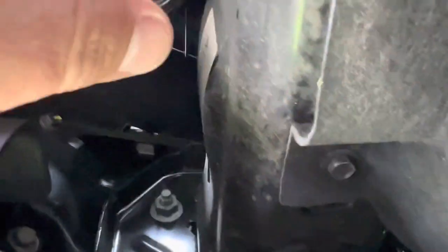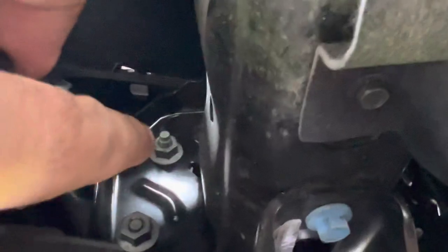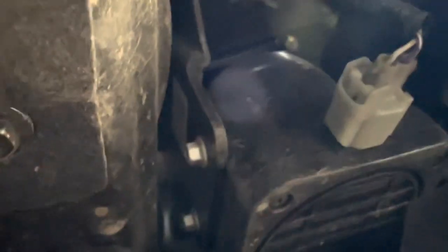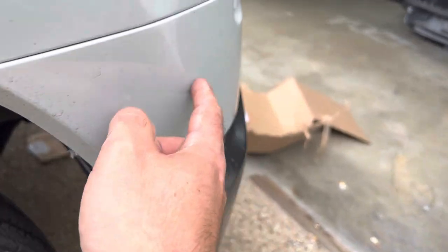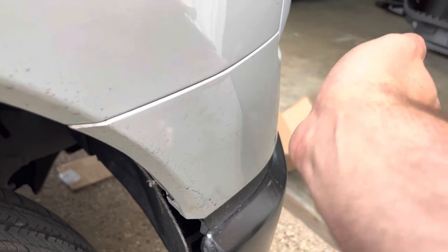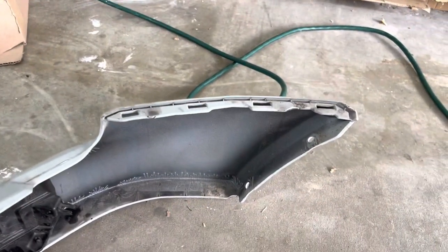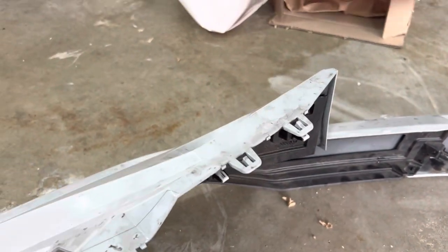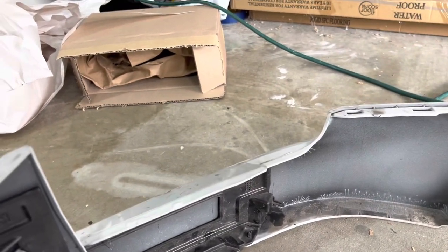Now to take the bumper off — here's the frame right here, and we have three 21mm bolts around it. There are two right here, one on this side, and then the same basically on the other side. I'm probably going to have to remove this felt piece to get to them. Next, we're going to remove this painted piece of the bumper by taking off these two screws, then slowly popping it around until it works its way off. Just slowly work it out. When you get to these pieces, you might take a flathead screwdriver to help them along. The bottom pieces are just push pins — they pull right out. Go slow and take your time. This probably took me 15 minutes.